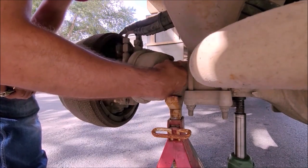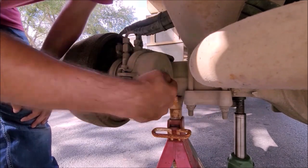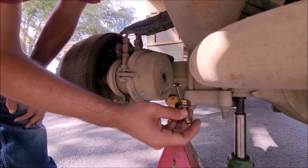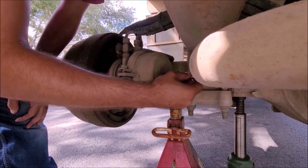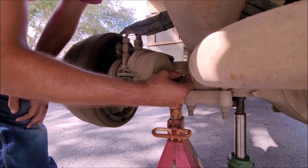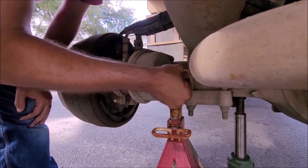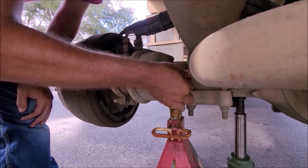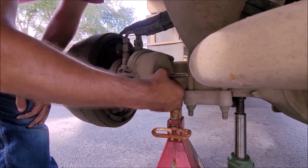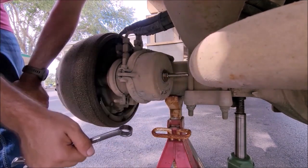The next step is to cage the brakes. I've never done this before — I don't think it's rocket science. Pull your plugs out and you can see there's a way for these cage bolts to fit. You put it in there and you're going to feel it hit another wall of some sort — you kind of got to twist it, get it in there. Once the prongs get past it all the way, you don't want it to pull out. Turn it like a quarter of a turn and you should feel it lock into place. Pull out on it, feel it lock, twist it to make sure, and then tighten the nut down. These are three quarters on these cage bolts, and you're just going to tighten it by hand until you feel it stop. You're going to have to do it on both sides.